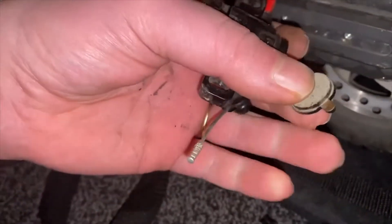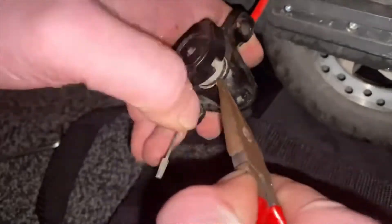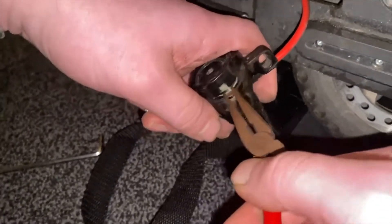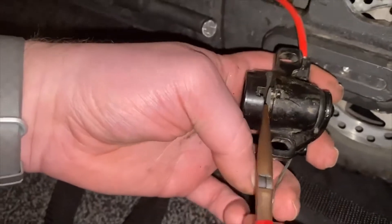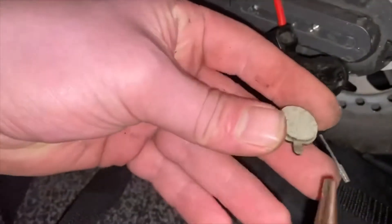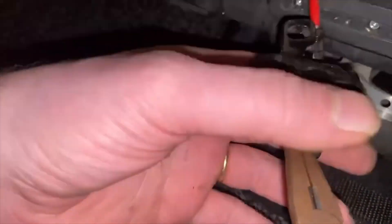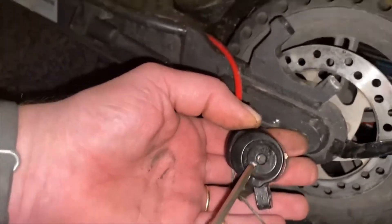I'm going to demonstrate putting one brake pad in. Once you put one in, the other one won't fit — and that's because you have to put them in a certain way. I put the one in on the right first. That one's in and it's held by a magnet. But now I'll show you the mistake: trying to put the second one in — it's not going in, because the other brake pad is now too thick since these pads are new.